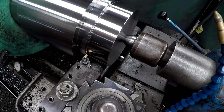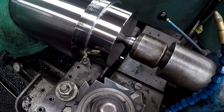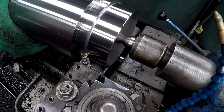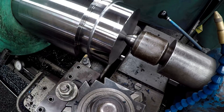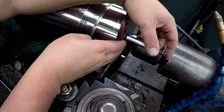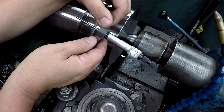First thing I'm going to do is just clean it up, get rid of that material there. I'm just going to blend that journal in, just like so. I took five thousandths off that shoulder, I'm going to do this again. Sorry that my hands are blocking - I'm trying to get in here and work. It showed a total of six thousandths taken right there.